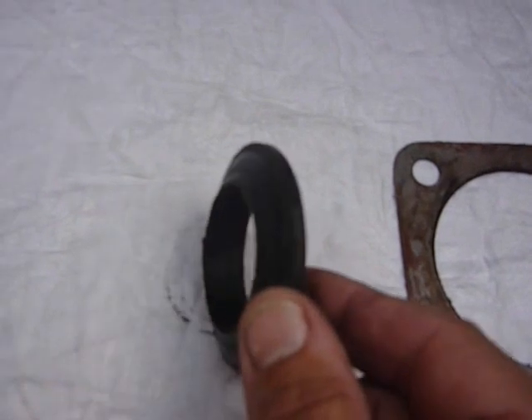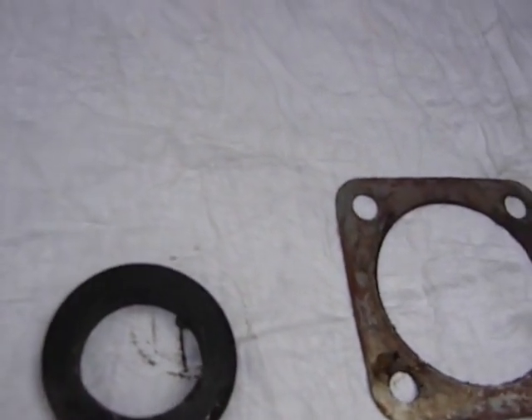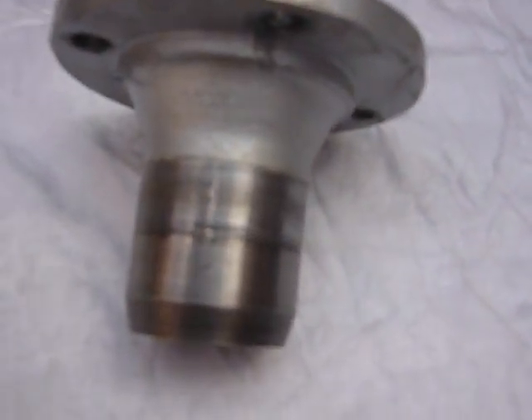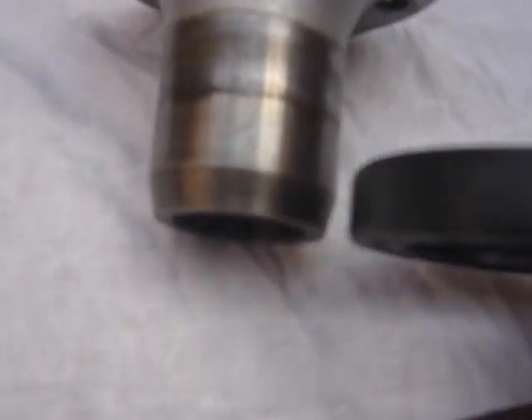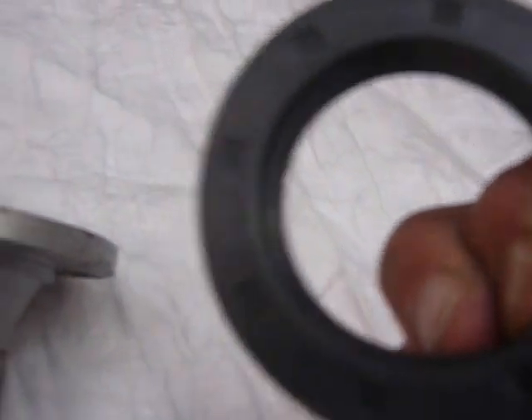Because of the way this works, it unfortunately gets a bit of dust in it over the years, and it's under compression, and of course the prop shaft is turning millions of times in the life of the car. You can see at the front here where this sits it gets a little bit worn — that's the nature of the beast. Today the modern seals look like this, and luckily there's so much spare unused shaft here, we'll be putting the new seal so it sits on the unworn piece, not on the worn piece. There's enough pliability in it that it would probably even work on the worn piece, but let's head for the good bit straight away.